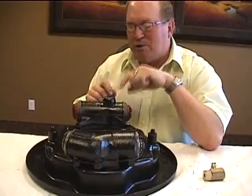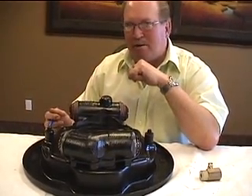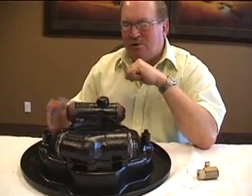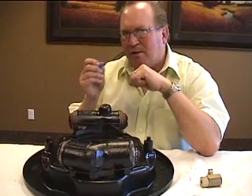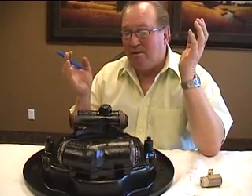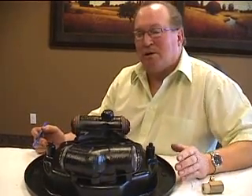When you scratch the bore and increase pressure — you've got fifteen to eighteen hundred pounds coming out of these cylinders — and you scratch the bore, you allow the brake fluid to transfer from one side of the cup to the other and now you've got a leak. It's just a matter of time before it works its way through the boot and your cylinder is leaking.